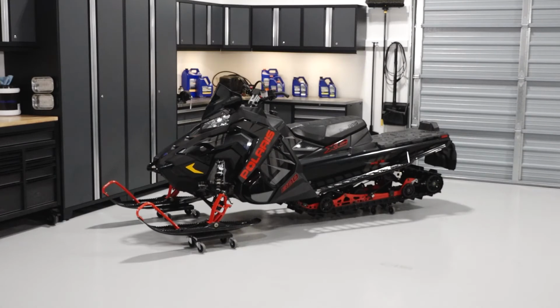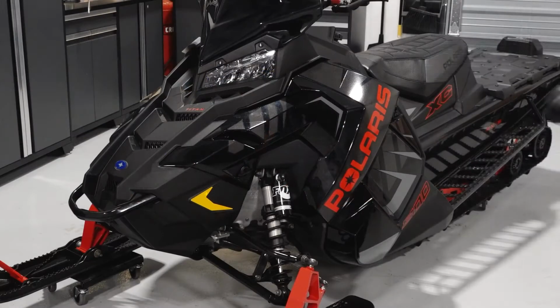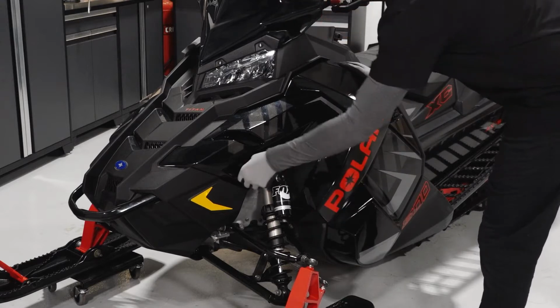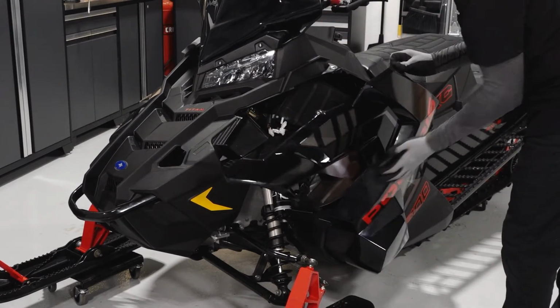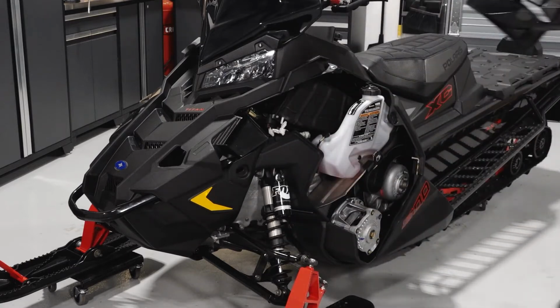To inspect and replace the spark plugs on your Polaris Titan, follow these steps. Park the sled on a flat, level surface. Remove both side panels by releasing the rubber strap and turning the 2 quarter-turn latches. Pull the panels out and lift up to remove.